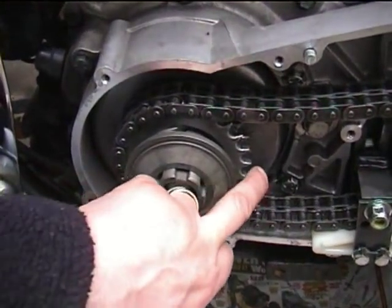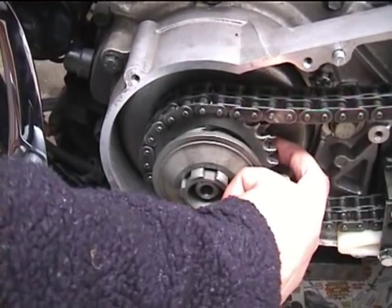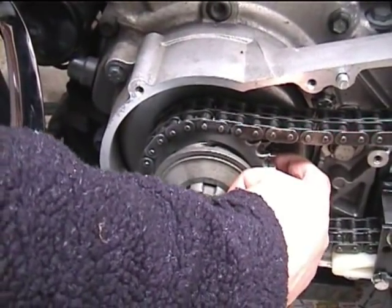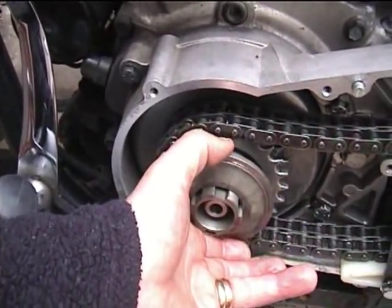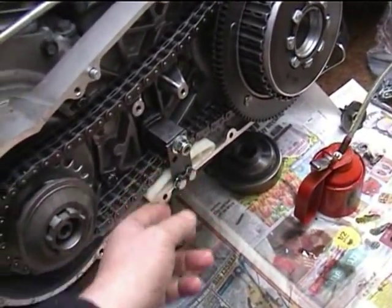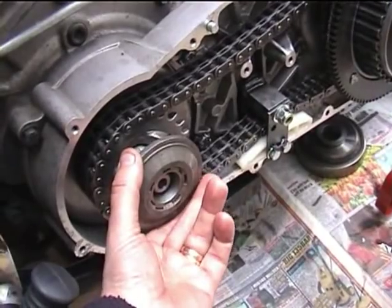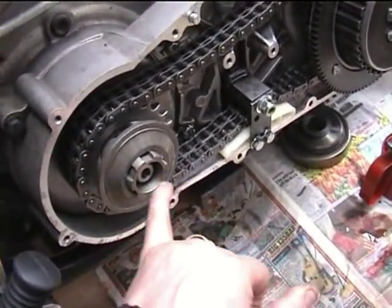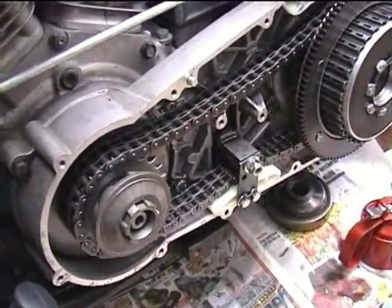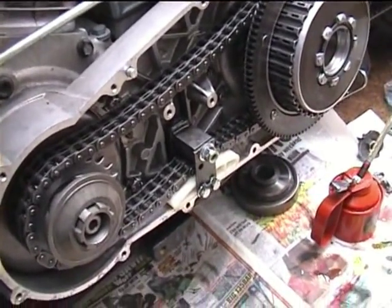One thing I need to say: just make sure that behind all this, right next to the stator cover, there is a washer. That washer was part of the assembly I took off — it's a spacing washer, the Clymer manual shows it. Just make sure it's in there. So it's the washer that goes next to the stator cover and then the rest of the assembly goes on to it. Both of these are now on — loose bolt on there for the minute, I'll tighten that up later, get the right tension. Two drops of Loctite on there and on the thread — I've just cleaned the two bolts with meths.